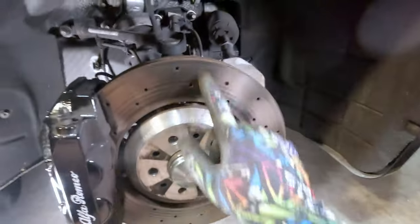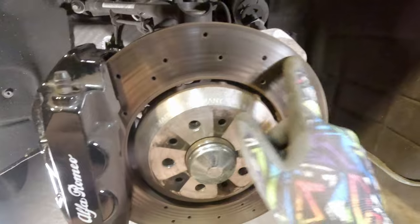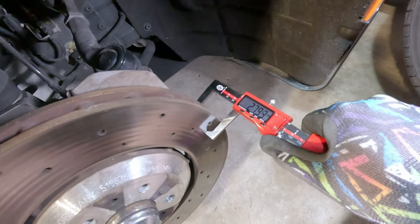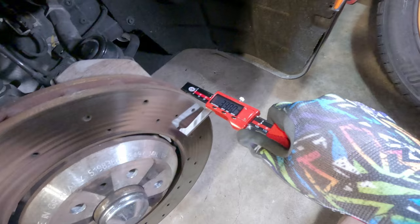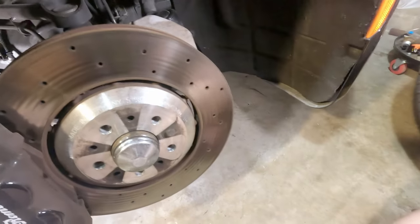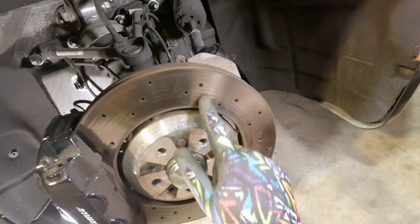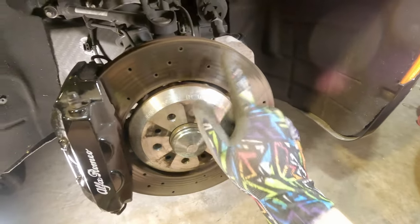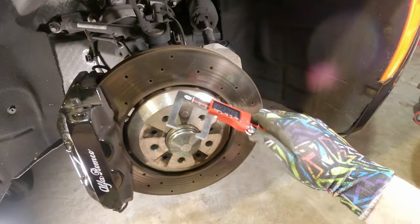When I was getting ready to put my new wheels on, I noticed there was some grooving going on on my brake rotors. The rears were fine but it was only on the fronts. I've got these digital rotor calipers, which are really handy for measuring brake rotors. It's reading at 27.8 millimeters — checked a few spots, 27.9, 28. The rotors are within spec; the face of the rotor says 26 millimeters is the minimum thickness. The grooving doesn't seem too severe, so I'm planning to replace the rotors when I get back. I'll leave a link in the description — they're super handy and pretty inexpensive.